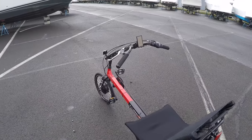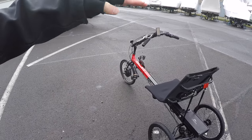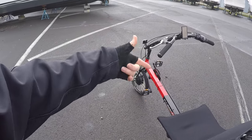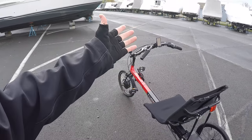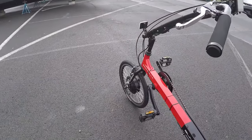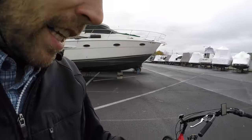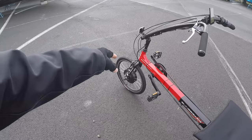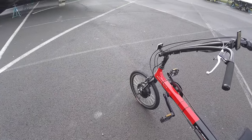The top speed on this trike is going to be about 20 miles per hour, but you can dial it in lower if you want. You can change how responsive the pedal assist is and even change the amperage flowing out so it could be less zippy. I've noticed that at times, depending on the terrain — and I only weigh 135 pounds — there's a little bit more weight toward the rear. So if you just gun it using only the throttle, the front wheel can spin a little bit. It's nice to kind of ramp into that power.